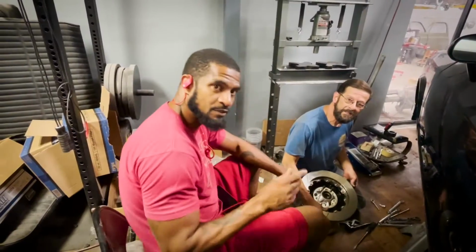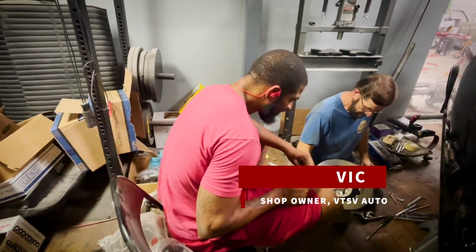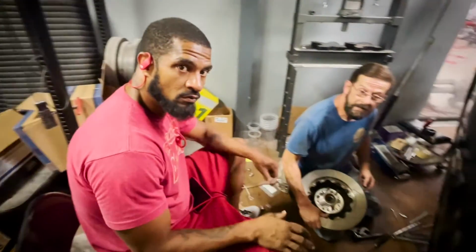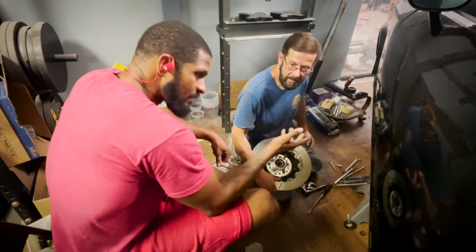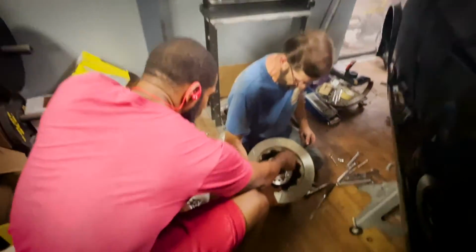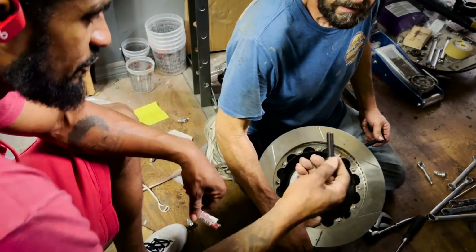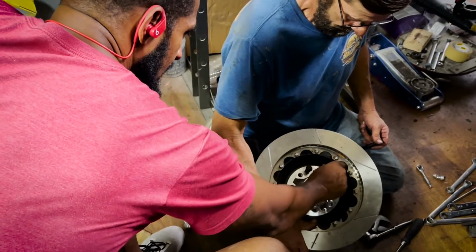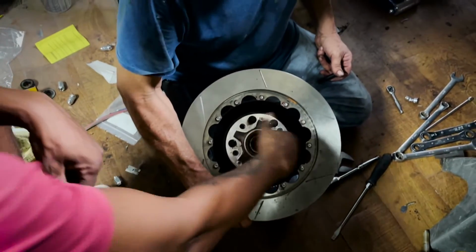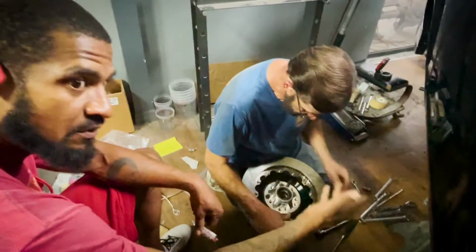I just wanted to come, feature alert real quick, short and sweet. Something that I like about the Wilwood kit, Butch came and asked me where the wheel studs at. If you know your old wheel studs, they were press-in wheel studs, not necessarily with a hammer, but you could use a press. What I like about the Wilwood hubs is it's threaded. So you screw them in from the back, and you don't have to worry about having a press. Obviously you torque them down, and then once you put the nut on the other side with the wheel on, obviously the hubs are in.